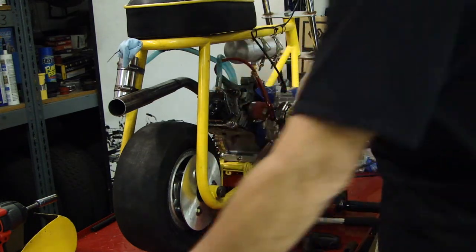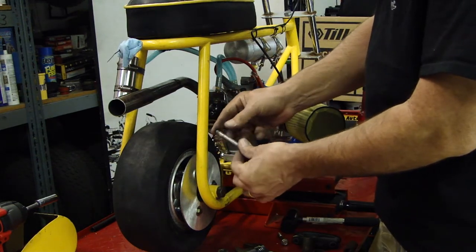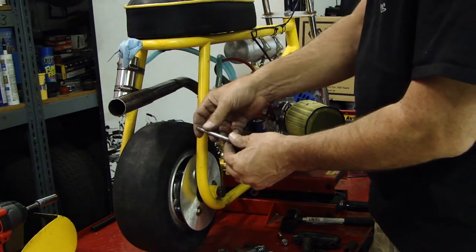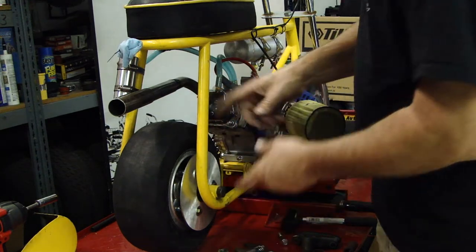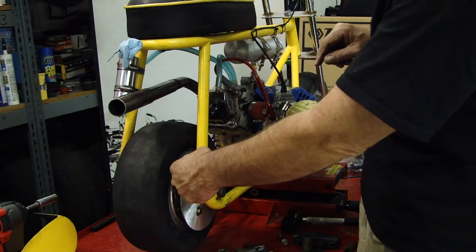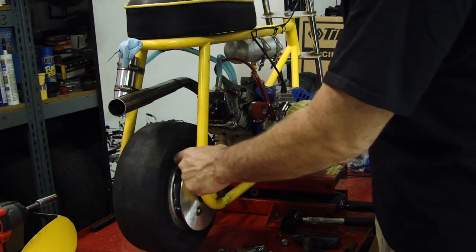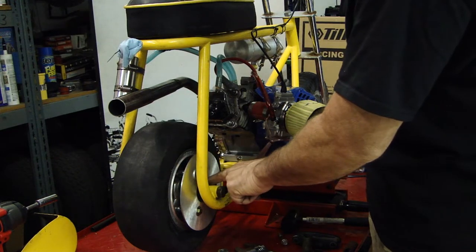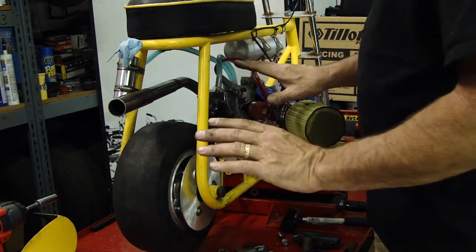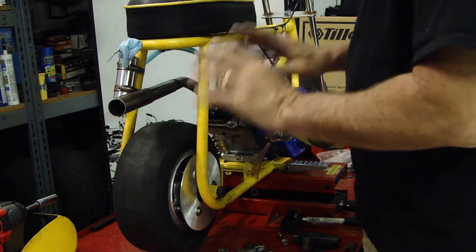Basically went from a 3-inch bolt, which is what held the wheel together by itself with the sprocket hub on the other side, to a 5-inch bolt, okay? And then the addition of 3/4-inch spacers in conjunction with the hub adapter worked out perfectly. Right offset, right fit, it just made it very, very easy.